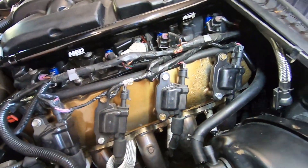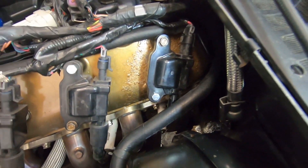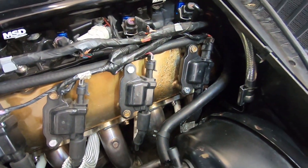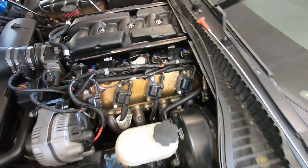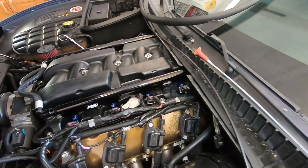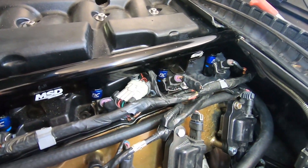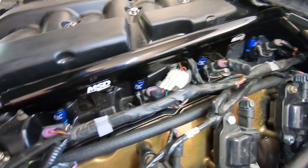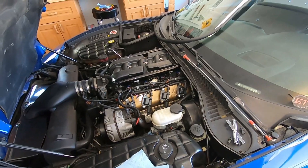I've spilled fuel so many times that I've ruined the valve covers down here, which is a bummer. I didn't use engine paint, so heads up — it held up fine with heat but fuel did not like it. Eventually I'll replace that. I also had issues with fuel leaks coming from the fuel injectors themselves — they were just out of alignment, so I made sure the o-rings were good to go and sealed it all down.